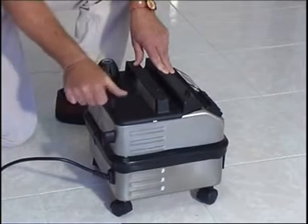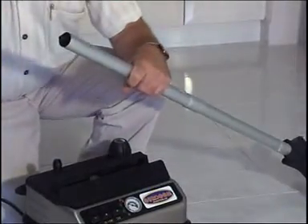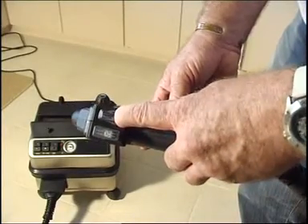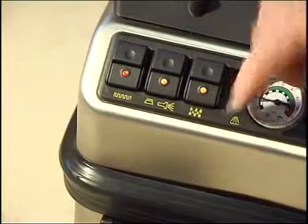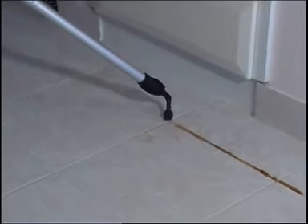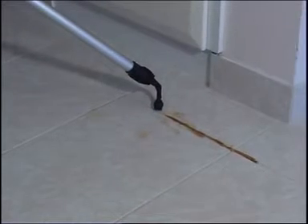Our most common cleaning task is the floor, so let's start with grout and tiled floors. Fit the extension tubes to the main hose handle, pushing each tube on so the press-button locking device is in the correct position. Attach the single aperture nozzle and the small nylon brush. The SC4000 has two switches on the main hose handle: the left button is an on/off switch for steam production, while the right-hand button is a hold-down button for the additional hot water blast. Press the steam button and allow the nylon brush to move slowly over the grout line under hand pressure — you don't need to apply heavy pressure. If the stain is stubborn, just dwell on it for longer.